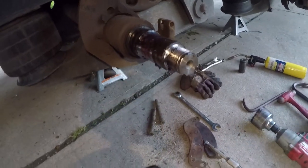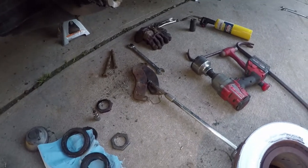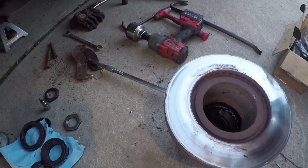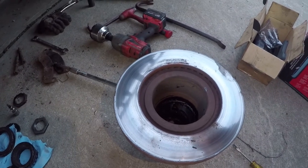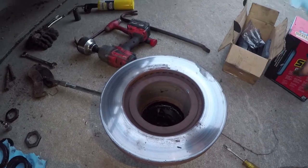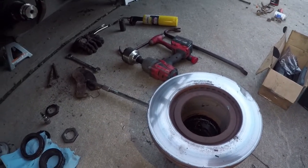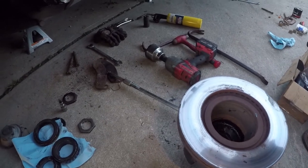So if you've got a new trailer, the Lucas Hub oil will help - it'll get you to a repair shop, at least a half dozen times. But once it totally blows out, don't try to limp it. If you put it in and it pours right out behind the tire, you're done. Jack the axle up, chain it up, get it to a shop - pull the tires and stick them under it.